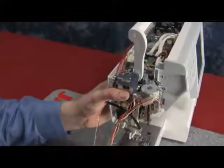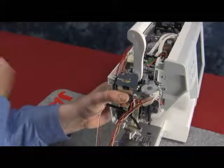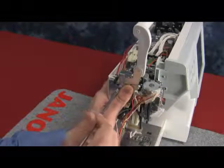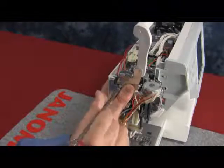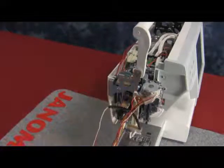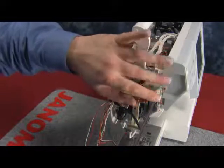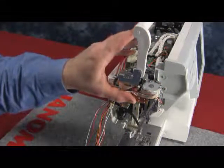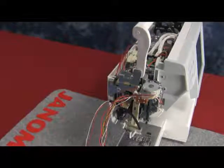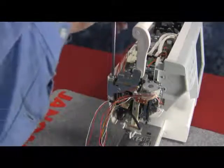While holding it there, you will need to grab one of the large Phillips head screws and put it into position on the left hand side. This screw you will not tighten all the way. This way, when you put the second screw in, it will make it easier in case it has shifted or misaligned. Now replace the second screw, and this one you can tighten fully, and go back and tighten the first screw that you put in. Replace the screw on the top of the bracket, the rear panel, and tighten that as well.